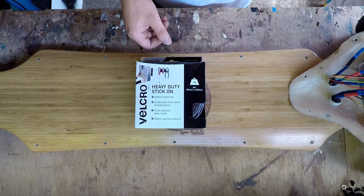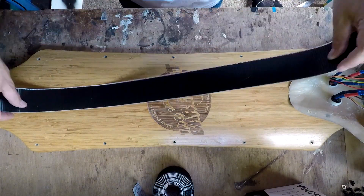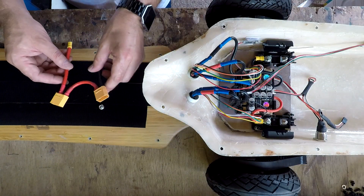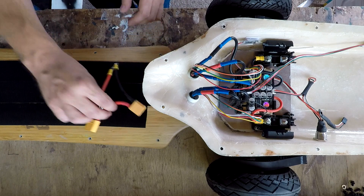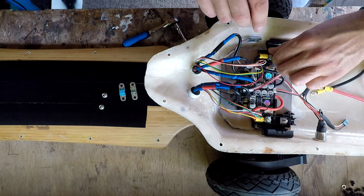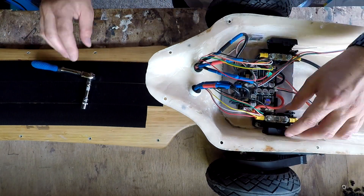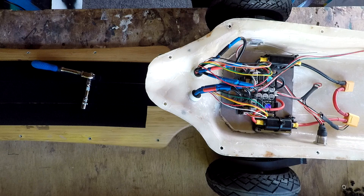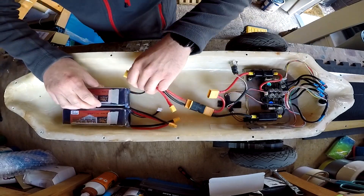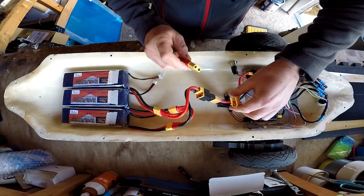To mount the batteries I'm simply going to use some heavy duty velcro — a flat sheet all over the base of the board — enabling me to move the batteries around to wherever I want. I'm using a series XT90 connector: one for the batteries and the other for an anti-spark XT90 connector to protect the VESC when I connect the batteries. I've also installed two 100-amp fuses on both the negative and positive of the power to help against any back EMF from the charging side of the VESC. I've also installed a parallel XT90 connector so I can double my battery capacity in parallel, extending the range. This is the anti-spark switch going in, which I do before I turn the board on.